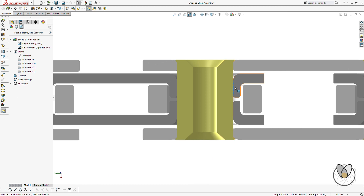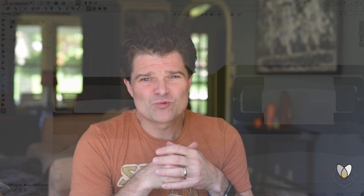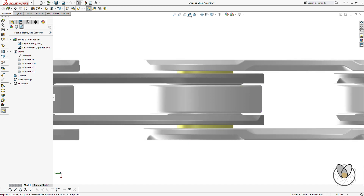As the chain is under tension, the inner plate faces are roughly touch-fitting — almost a zero-clearance fit to the pin. You need that because otherwise when you put sudden tension on the chain, all those little gaps would be taken up and the chain would want to stretch. That would feel funny to pedal because you'd have slack being taken up as the chain comes over the cassette. As a chain wears, what we're measuring is the wearing of the metal faces in that gap — as those surfaces wear down, little gaps form and the chain grows longer.